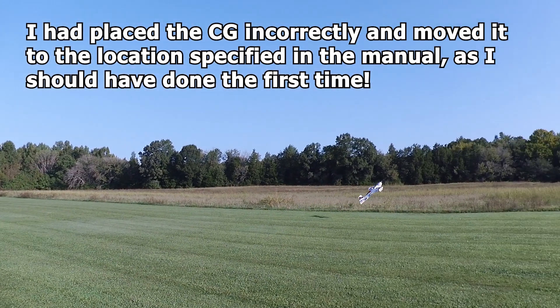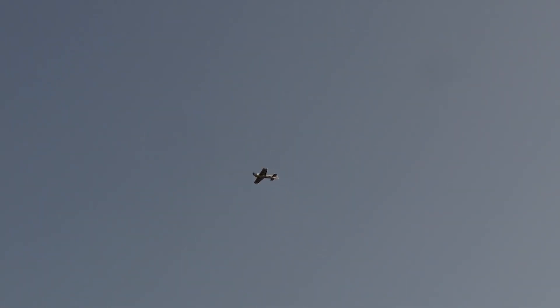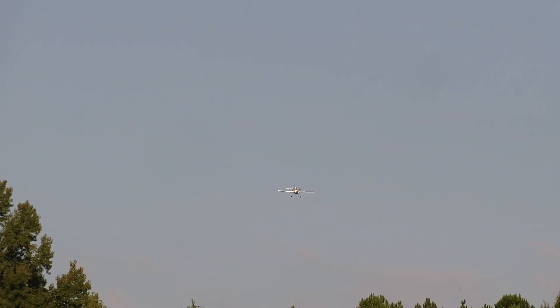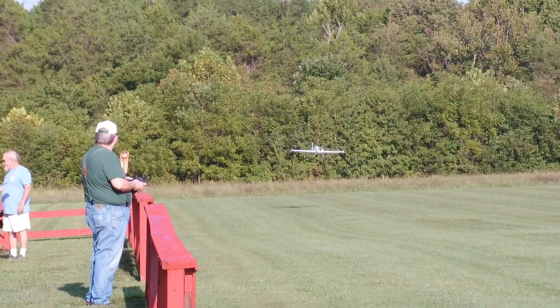Because I have a lot of experience with this plane, the main thing I'm looking for with the new CG is major trim changes or maybe some sensitivities. This was the first takeoff, and I'm not seeing any problems at all. Because I moved the CG to the rear, I was a little concerned about the elevator being very sensitive, but that didn't happen. I came right around and shot an approach because I wanted to see if this thing wanted to squat or anything on the way in, but it didn't — it stayed nice and level and was easy to handle.